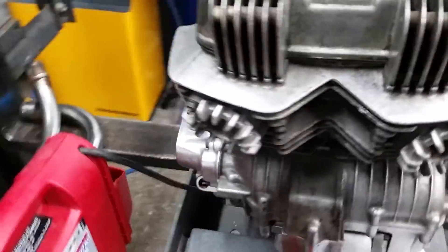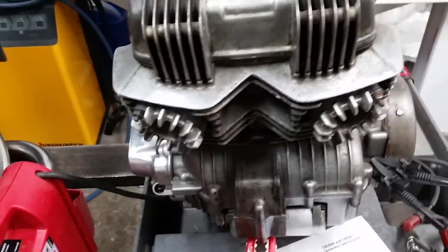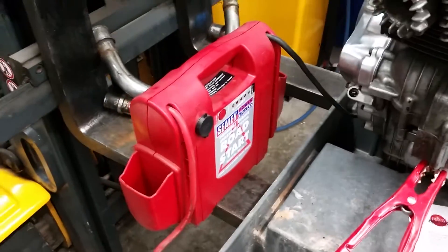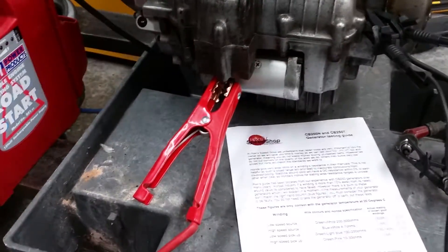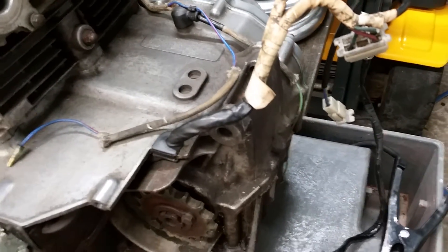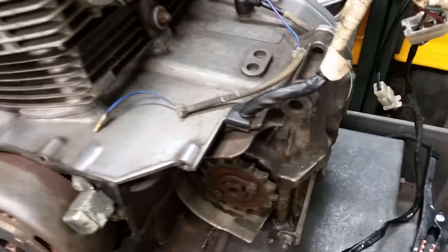As a final test, and bearing in mind I also had the booster out to crank it over to test the compressions, I'm doing that by just connecting the booster to the starter motor terminal at the front of the engine. My on/off switch is just manually clamping the negative onto the engine, and that spins the engine over fine.